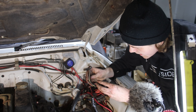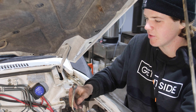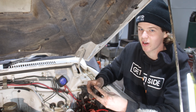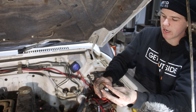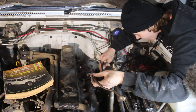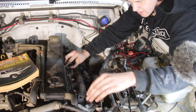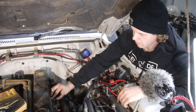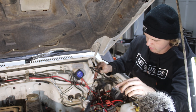These water lines are going to have to be cut and we'll put barb fittings on them. I was considering just cutting them and trying to flare the ends and sleeving a hose straight over, but because it's a high-pressure system you really want a good seal. So we're probably going to cut these and braze a barb on. This is the coolant feed and this is our coolant return — that bolts on down there. The easy one is the coolant return: cut it just before that bend and run the hose straight to the tee.